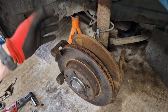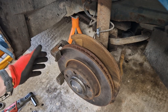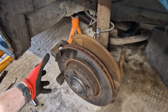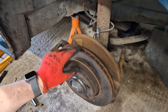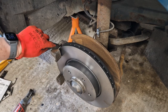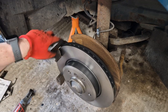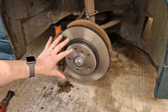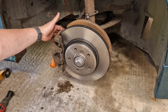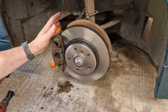It's worth noting that because we're using the existing calipers, we don't have to muck around with brake master servos or do anything with the braking bias — we just leave the calipers as they are and go with these discs and carriers to get that extra increase in size. With the disc and the new caliper carrier fitted, that space has closed up but we have plenty of space and free running for this 300mm disc. All fitted up nicely — the mounting holes for the calipers are exactly where they were on the original carriers.